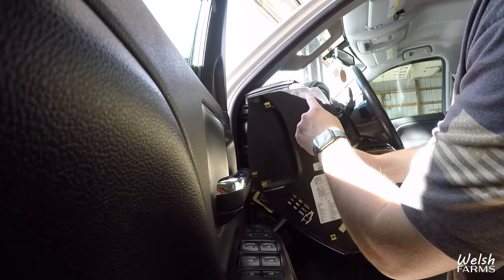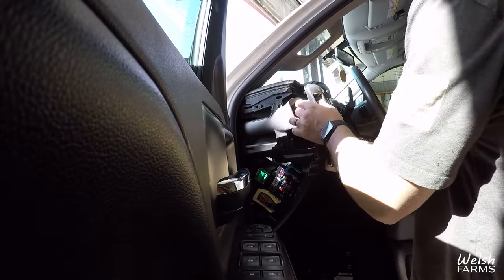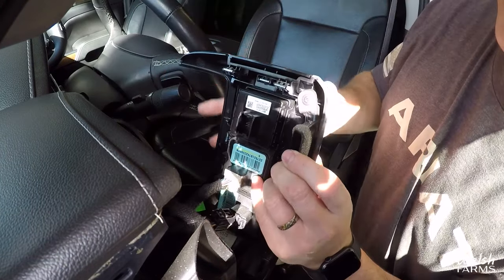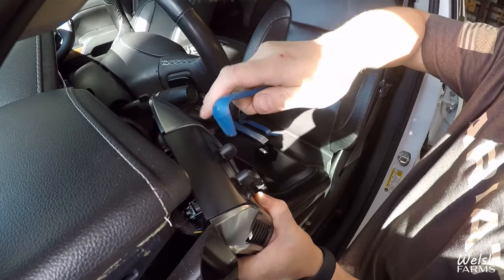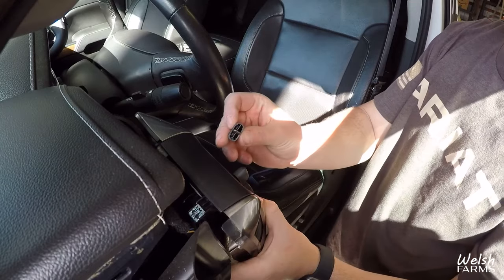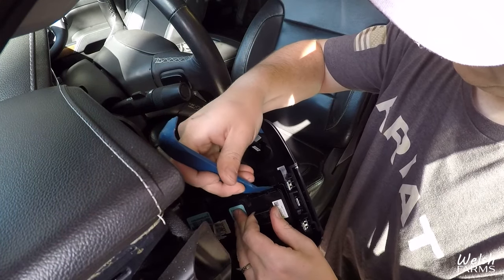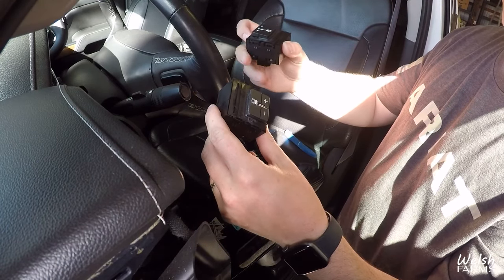Here are the clips that we just had to pop out. There are two of those same clips on top and two down at the very bottom, and then we simply unplug that top plug. You do need to take out these — I just pull them off of here. There we go. There's the second one. Pop out that tab, pop out that tab. There's our old switch; here's our new switch.